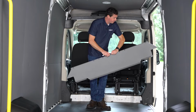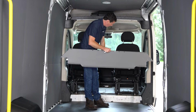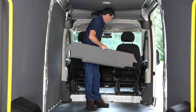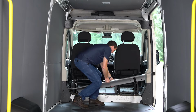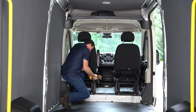Next, we're gonna do kind of the same thing that we did on the top, where we're gonna hold up our bottom wing up against, we're gonna line up these 2 outside holes with those D-ring locations. And then these 3 we're gonna mark. I've got a grease pen here so that we can drill our holes for our plus nuts right there. I'm just gonna hold this up to get my alignment, do my marks, and do my drills. Again with our drill stop.